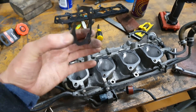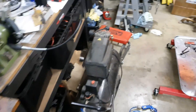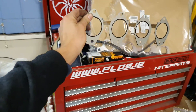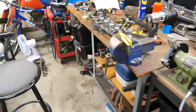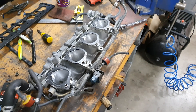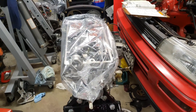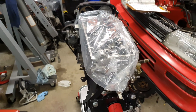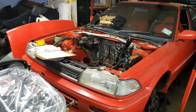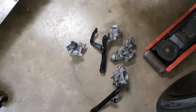Actually reusing these gaskets because my gasket kit has a full head gasket and everything, but no ITB gaskets - that's all right, it's not like it's holding fluids or anything, it should seal up pretty well. So that's my plan - bolt it onto the head and that should be pretty much it. Then looking at taking it off the engine stand and putting the clutch and flywheel on and dropping it in the hole and putting the gearbox on and bolting my manifold on.